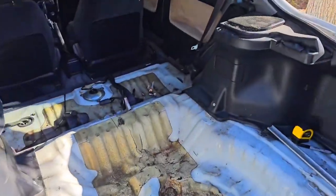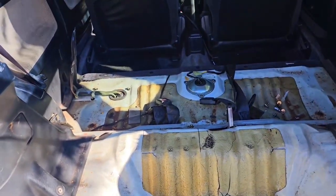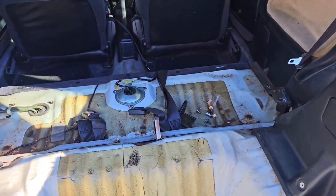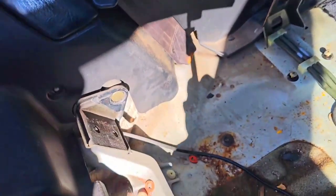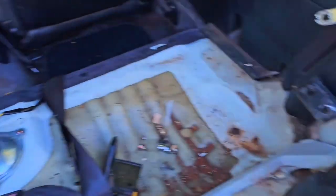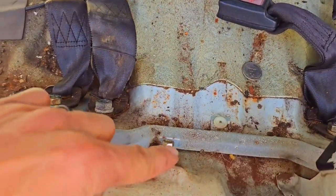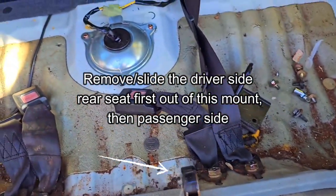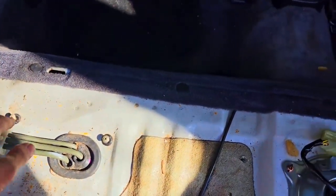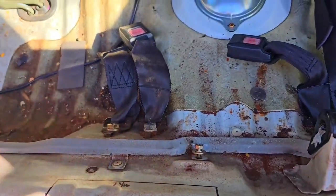With all that said, let's get this started. I've got it marked out, everything off — all the carpeting, rear seats and stuff like that. Let me quickly explain how to remove the seats. On one side you have a bracket holding in two 10 millimeter bolts, same thing on the other side. There's one hidden bolt that you need to remove for the bench portion of the seats. Then there are two metal brackets hooked on. Move the seat up once that bolt is gone — fairly simple.